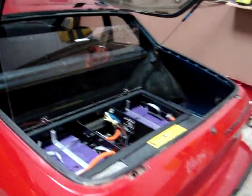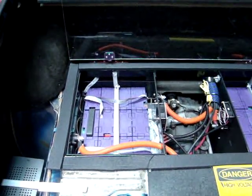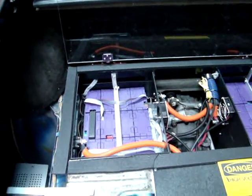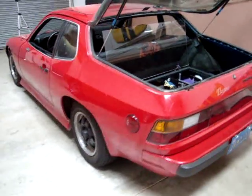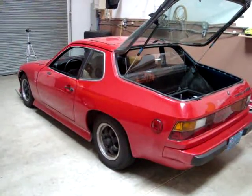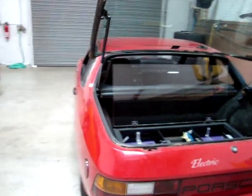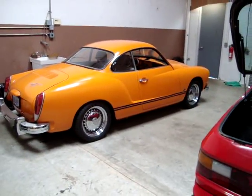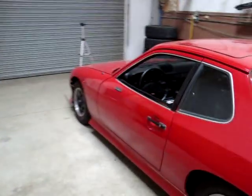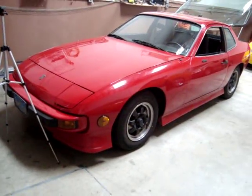This is what will be used in the Karmann Ghia conversion — GBS 100 amp-hour cells. There will be 44 of them used. The vehicle they are currently installed in is a Porsche 924. It has a 40 to 60 mile range and it's heavier than the Karmann Ghia will be when completed. The Karmann Ghia will be about 2,200 pounds; the Porsche is 2,630. So we'll have a lighter vehicle. The Karmann Ghia is also fairly aerodynamic — not quite as aerodynamic as the Porsche, which has had a few features added.